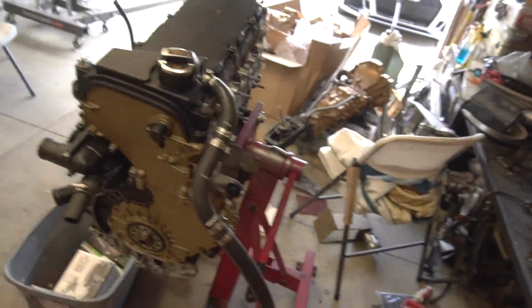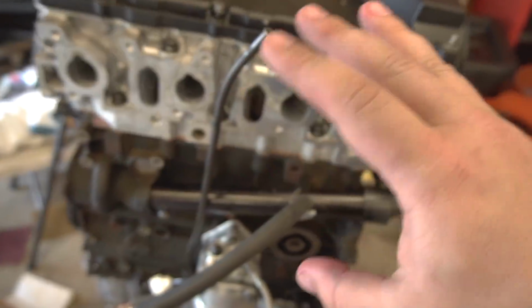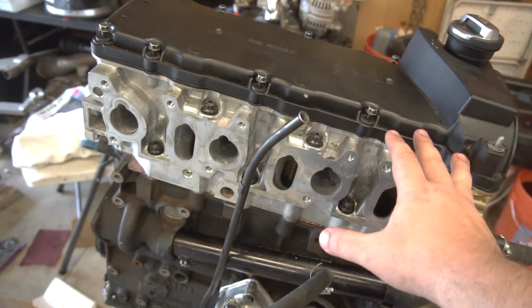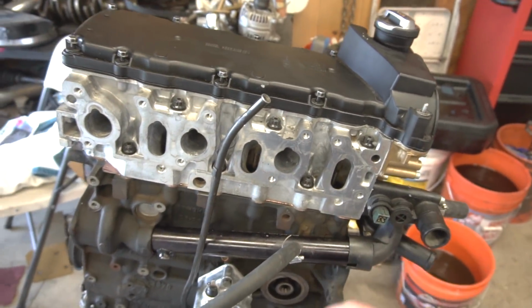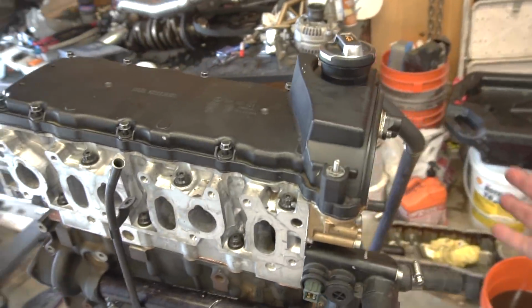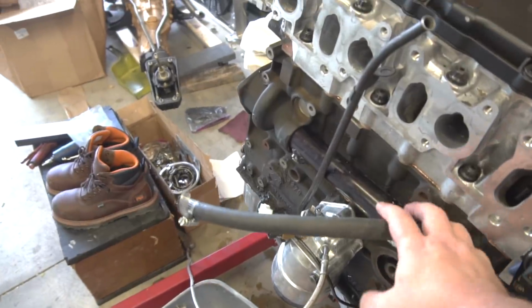Luckily, we had a spare 12-valve VR6, and this has just been kind of hanging out. So we refreshed pretty much everything on the stock block. Didn't re-ring it, kind of left that alone. Put ARP bolts on the rods, left the stock mains on, put a head spacer, brand new head gasket, all new timing components, and then some of Stavros' stuff from his motor that we tore apart.